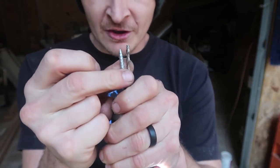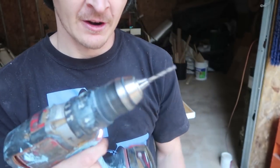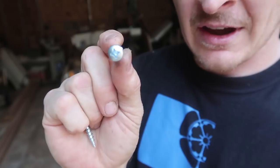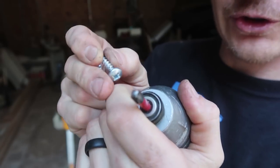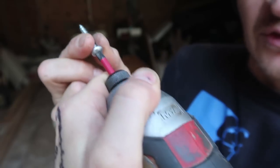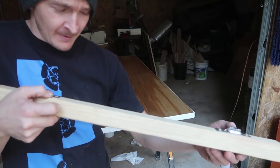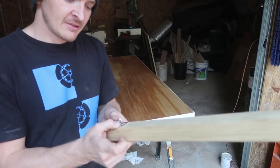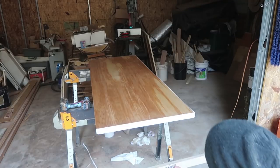I'll just hold the screw up to judge depth — I can go as deep as I need because there's a little extra depth with the wood on the door header. I find that when screws have this head it's best to use a bit that has both the square and Phillips — that gets you the least strippage. I used a one-by-one to make a temporary reference piece so I could copy the exact same placement and not have to play a guessing game.